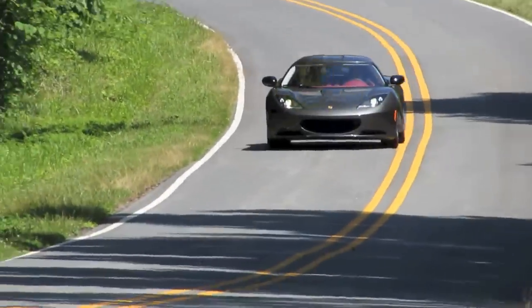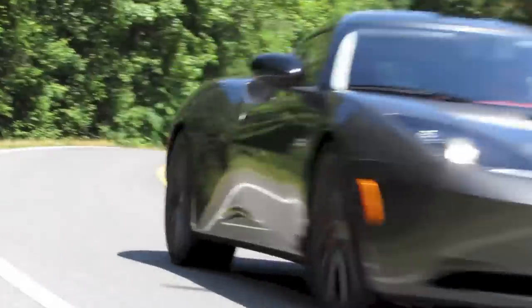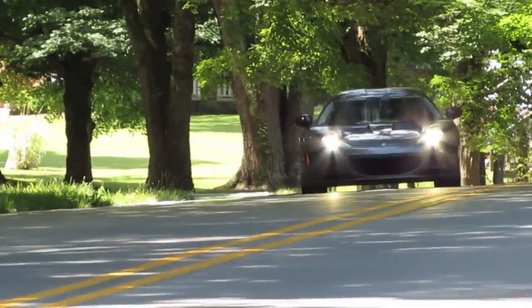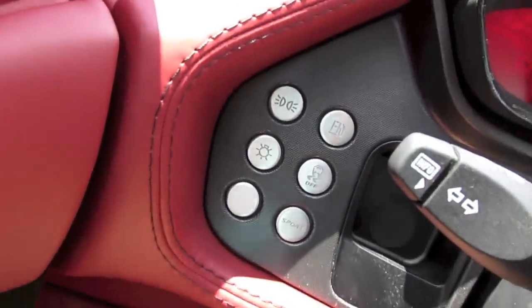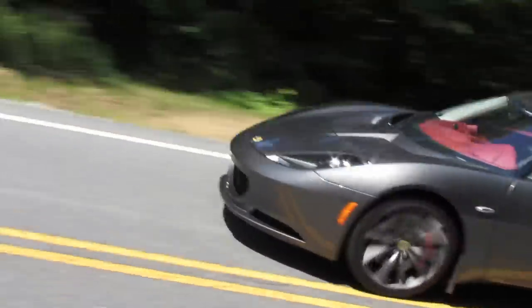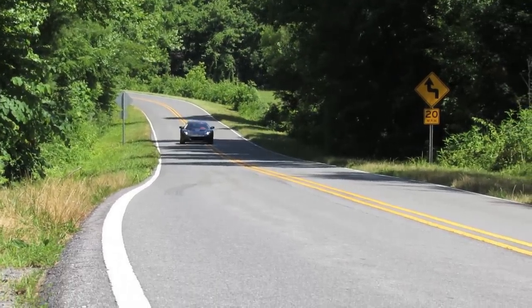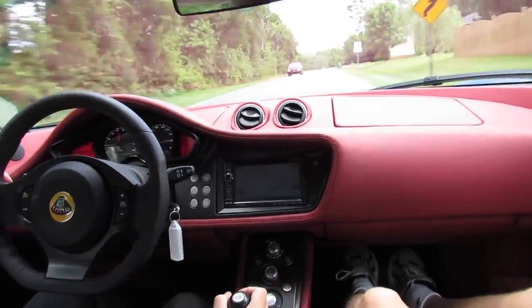I mentioned it a couple of times already, but now it's an appropriate time to go more in depth. The standard Evora can come with what's known as the Sport Pack — a sport suspension and performance system designed to give an overall increase in driving dynamics. The Evora S actually comes standard with this system. It's paired with Lotus's Dynamic Performance Management System, otherwise known as DPM, which is basically an addition to the Evora's safety features by offering extra stability and traction control when you need it most. With the Sport Pack, a little sport button located on the dash alters the DPM settings with the touch of a button for a heightened dynamic experience — it increases throttle response as well as the rev limit, and the exhaust bypass valve, which normally opens around 4,700 RPM, automatically opens at 1,500 RPM in Sport mode. In cars equipped with the IPS automatic gearbox with paddle shifters, Sport mode also increases shifting firmness, giving you a little bit more feedback from the transmission.